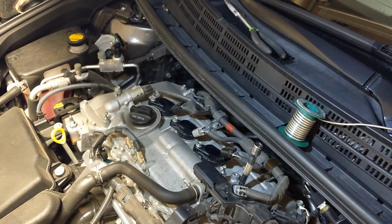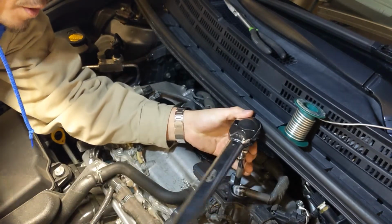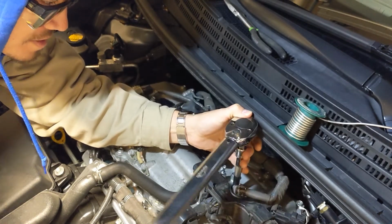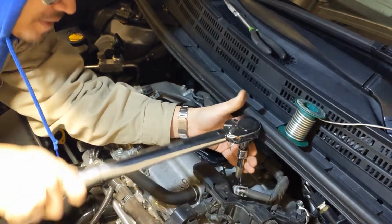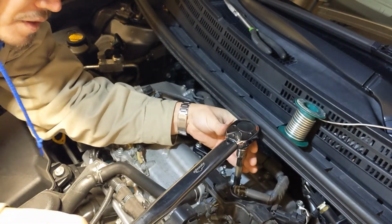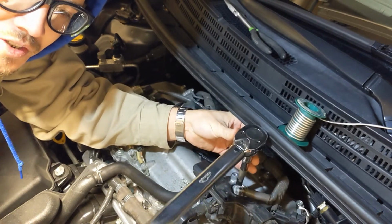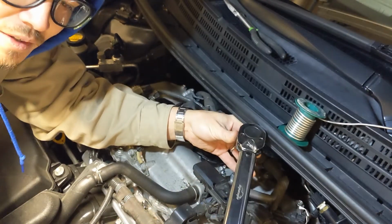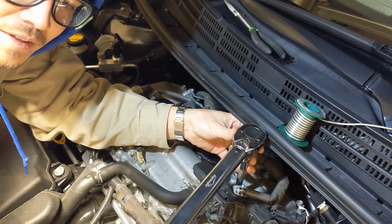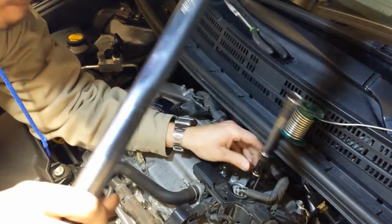We're going to torque it. A torque wrench is necessary because your torque is going to be specific, 10 to 13 pounds of torque, which is not very much, but it's tough to know. I have to listen for the click. It's not very loud. I got a cheap wrench because I'm an at-home mechanic. Oh, you hear that?